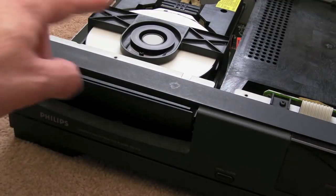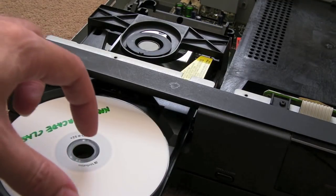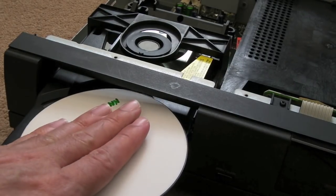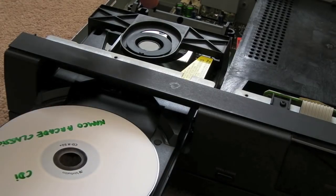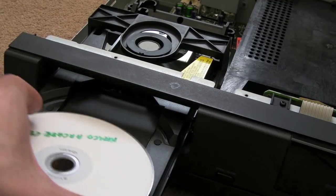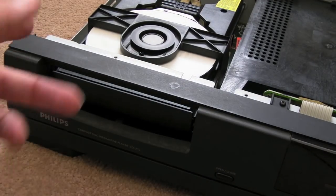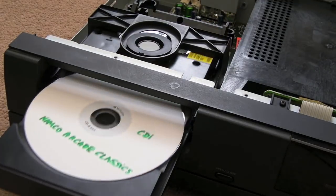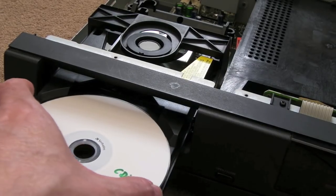But I would suggest that certainly on the 210 model, that's a common fault. These tray loading drives, and I've seen that on other systems, I'll try and demonstrate without actually breaking the thing. You put the disc like that there, and when it goes in you've got this extra height here, so as the thing comes up, it can put pressure. That mechanism doesn't work right. You can put pressure on the spindle, and depending on what you then do to try and correct it, you can actually press the spindle down. It really is that easy. The other possibility is if you stuck 2 discs in there, a similar sort of thing would happen, I think. But I can't imagine anybody's going to stick 2 discs in there at the same time. More commonly, you do something like that, or like that, and it's not in the tray properly.